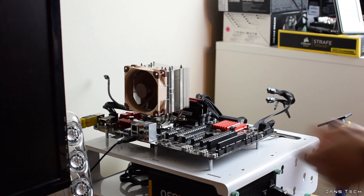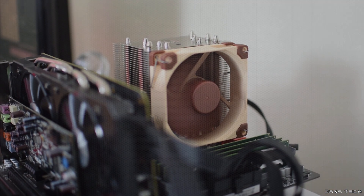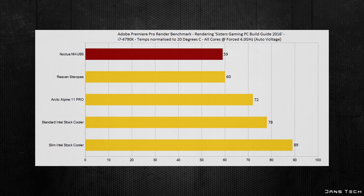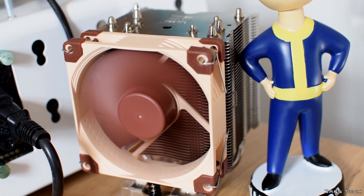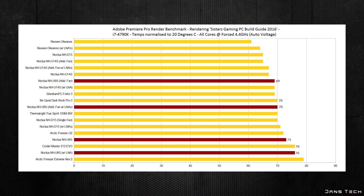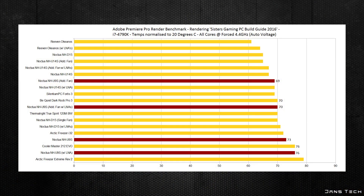Finally, onto the performance. As this cooler isn't very large, I first tested the cooler with all four cores on the i7-4790K locked at 4GHz with automatic voltage set. The cooler scored a low 59 degrees, really beating the Intel stock cooler, which wasn't really expected. So we decided to test it at 4.4GHz with automatic voltage set, just like we do with all the other high performance coolers. This cooler is able to keep the chip at 73 degrees with a single 92mm fan running at the standard PWM setting. It's quite impressive that a cooler this size can beat out the Hyper 212 EVO by Cooler Master by 3 degrees, and with an additional fan can beat out the massive Be Quiet Dark Rock Pro 3. The other tests are also in the graph. By adding the low noise adapters, the performance decreases, as expected.